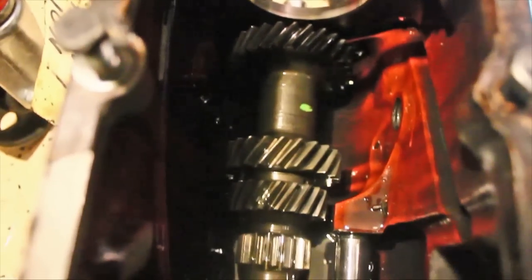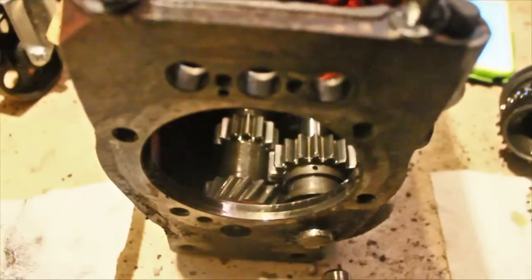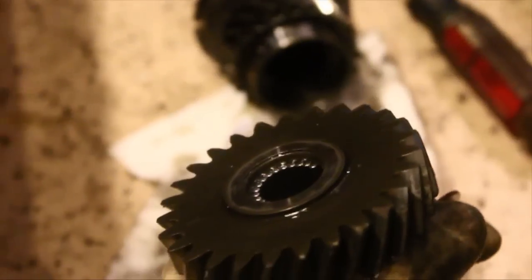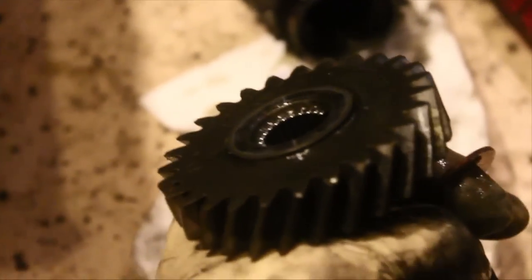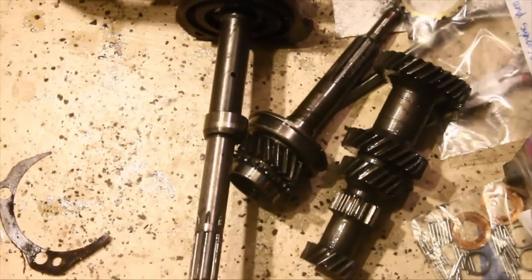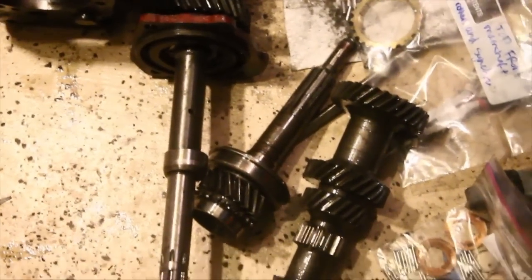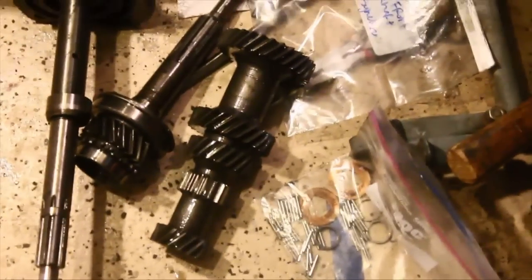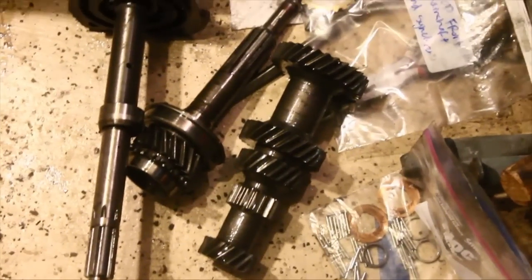Remove the counter shaft as a whole assembly, lift it, and bring it out this back hole. When I removed the counter shaft, all these tiny little roller bearings came out of it — there's others in there too. Look at all those roller bearings just ready to come out. That counter shaft has tiny little roller bearings on either side of it, and those are kind of tricky. There are four retainers that go inside, and then there are two copper washers. You need to know the inside and the outside and mark all that. But as long as you stay organized, it's actually not so bad.